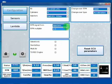In the same way, if you have the RPM wire connected, you can select the number of coils to make the RPM match what you see in the cockpit of the car. This procedure is not usually needed because during the auto calibration the software makes this selection automatically.